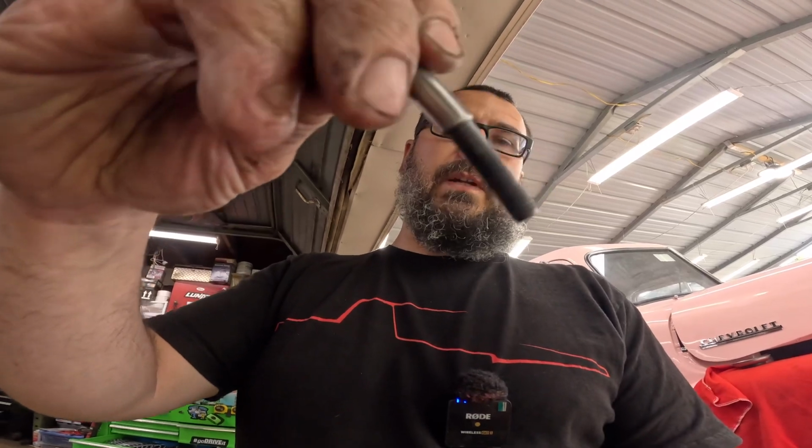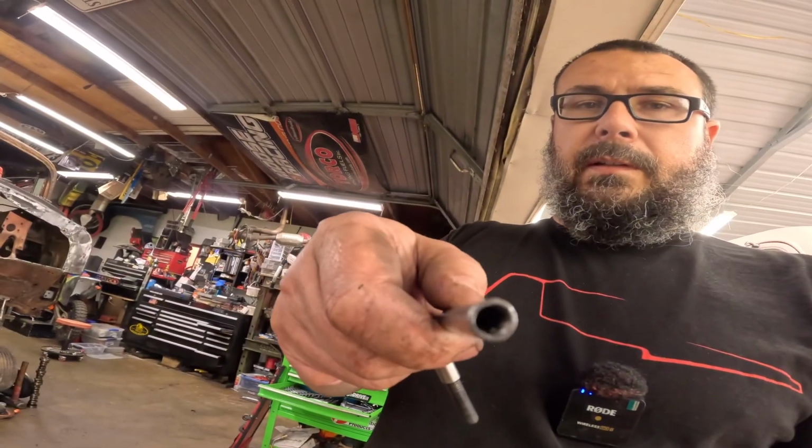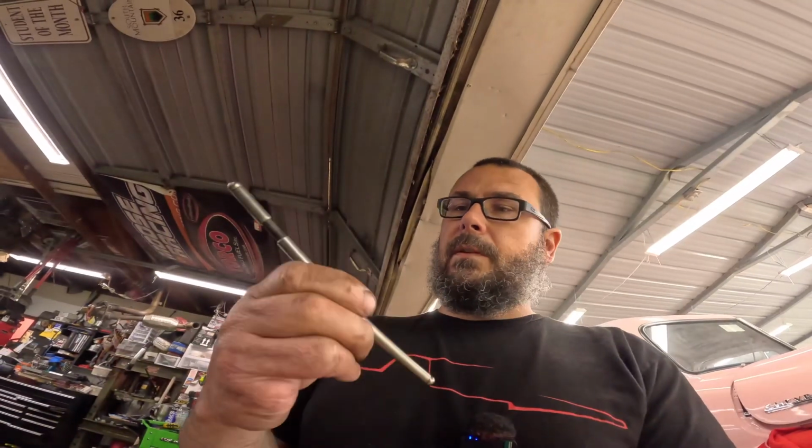But lo and behold, a factory LS push rod is a 70 thousandths wall, so it's a pretty healthy rascal. So it's enough wall to where I could tap it 1/4-28, and I used a bolt that I cut off, tapped both ends, and then down inside this end is actually a Bic ink pen spring. I don't know if you can see it or not. There's an ink pen spring in there to hold tension on it, so the adjustment's got a little detent, so to speak. But it's adjustable, it's strong, and it was pretty much free.